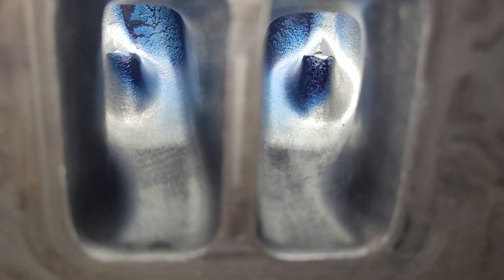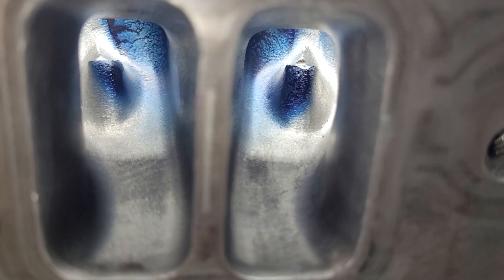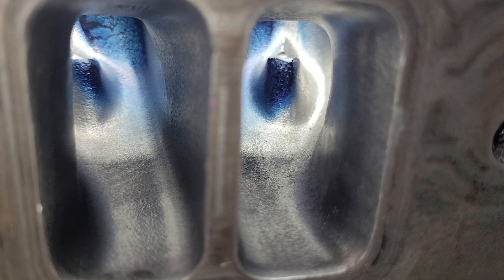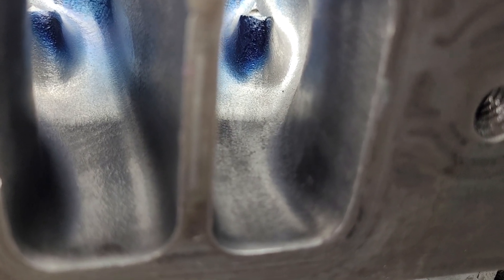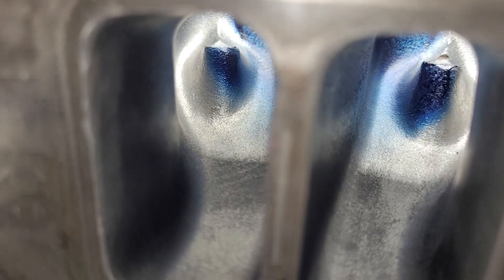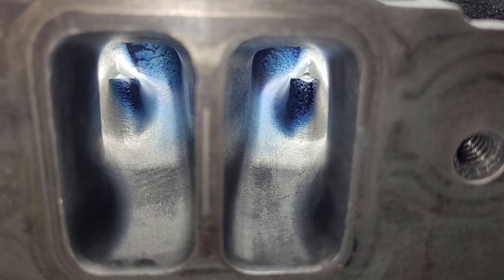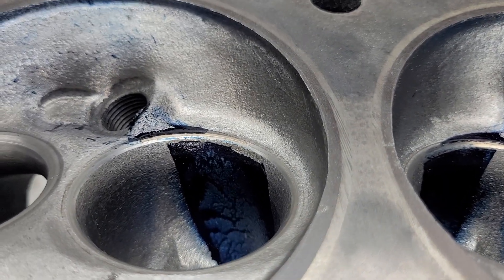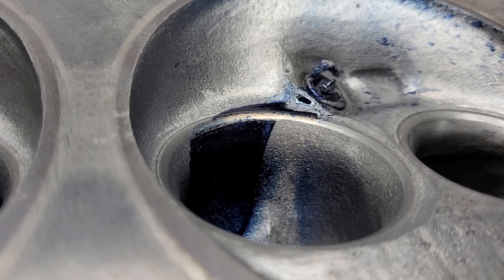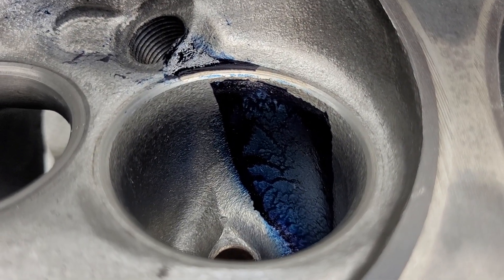In theory, I would think the one on the right is going to move more fuel over to the center, because the bowl — I should say the roof — is moved over more. 50 thousandths, you'll probably be able to see it. As far as our flows, I know it's going to mess with our swirl, there's no question about it. But as far as what we've got here, I'm pretty sure I could live with it, and I don't have to push these bowls dangerously thin. They're still nice and fat and healthy the way I like them.